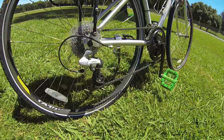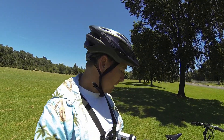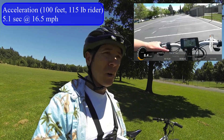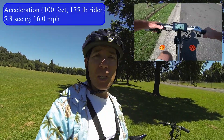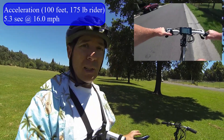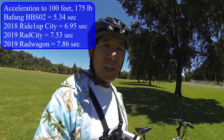You could go with an even smaller ring, but with this gearing setup she's got a probably 11-to-32 out back, and it really moves — she's gotten a little over 30 miles per hour top speed. My zero-to-100-foot testing on the acceleration: she — at 115 pounds — did it in 5.1 seconds, by far the fastest bike I've tested. For me it took 5.3 seconds and I'm 175 pounds. A 60-pound difference in people and barely any difference in speed means it's dealing with the weight of the bike and rider very easily. I think it's an impressive kit and I really enjoy it.